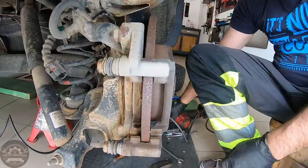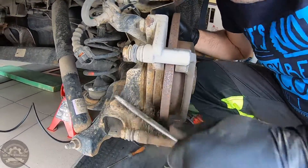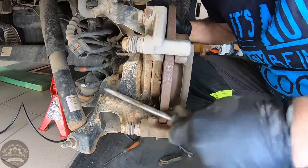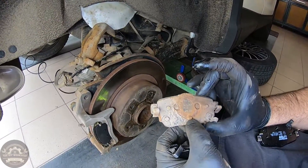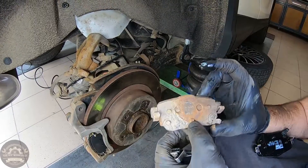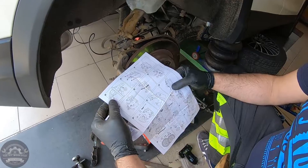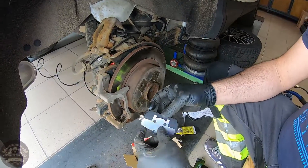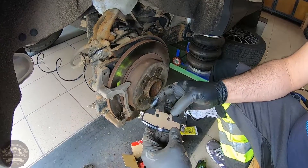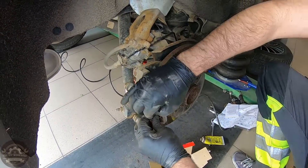In order to understand which of the new brake pads goes on the outside and which one goes on the inside, just check the wear marks on the old brake pads. Obviously you can tell that this one has to go on the piston side. The new TRW brake pads also came with replacement instructions and two types of protective metal plates. The plates are designed to help the brake pads slide on the caliper's bracket with less friction, and they do not rust as fast.